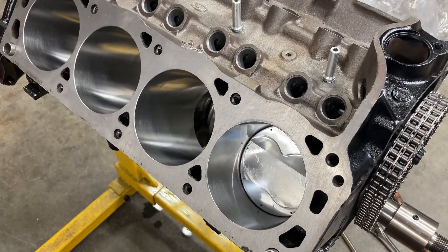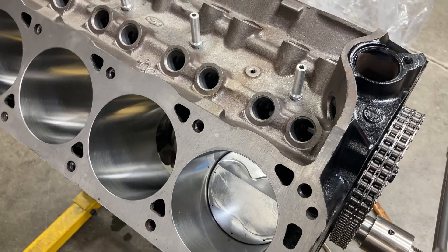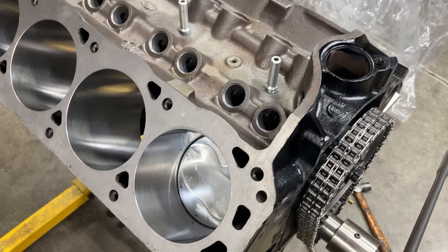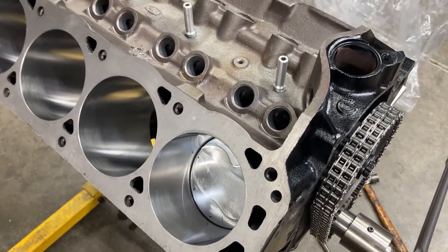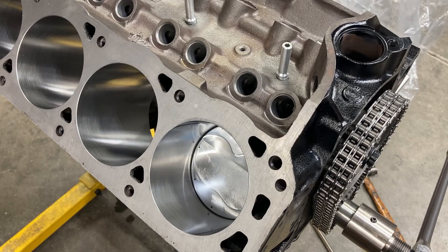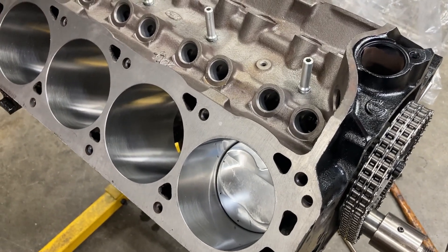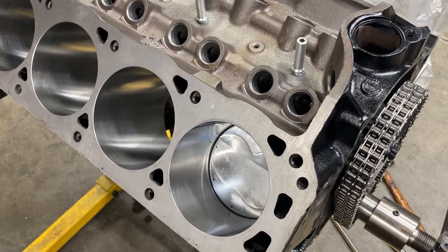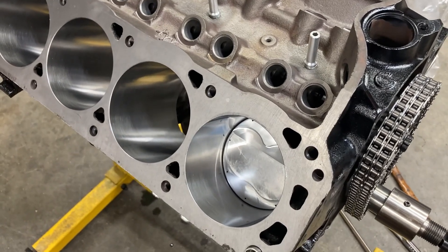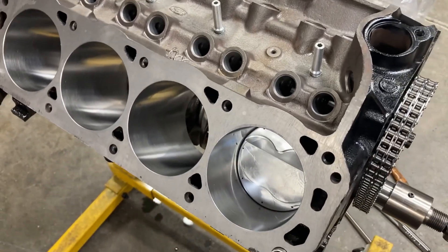This is Brent Likens Motorsports. Came home from church this morning and decided to try a couple more things on this 311 before I go and have the pistons cut. For one thing, I don't think I can have the pistons cut — I looked at the piston sheet and the crown thickness is set at 210 thousandths, and if I were to cut enough to make it perfect the piston would be too thin.